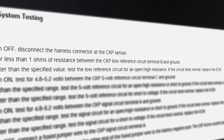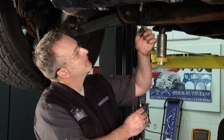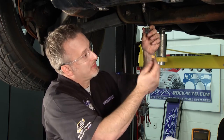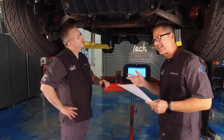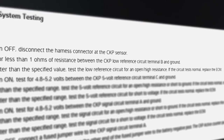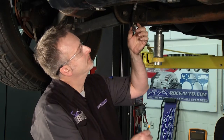We're going to the gray-with-black wire — that's the one in the middle. Trip, turn the key off so we don't have voltage when testing ohms of resistance. We should add that we disconnected the battery before removing the starter — important step. We then reconnected it and taped up the wire harness just to be safe so we don't get any arcs. We want to check the ground circuit — looking for a resistance problem — between the crank position sensor low circuit reference and ground.